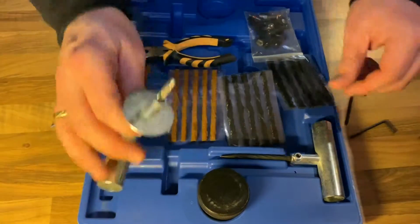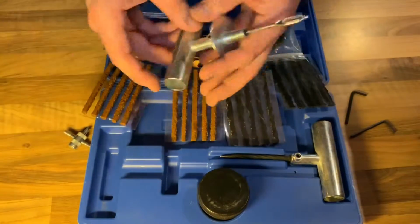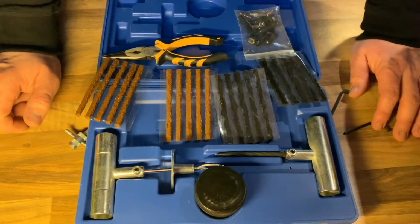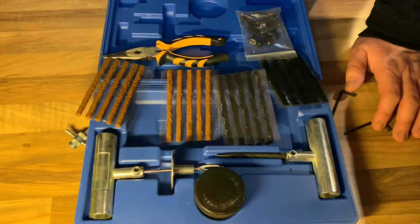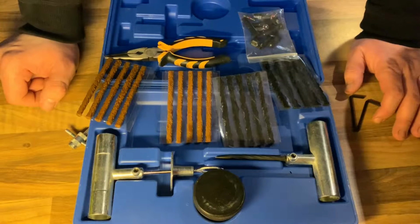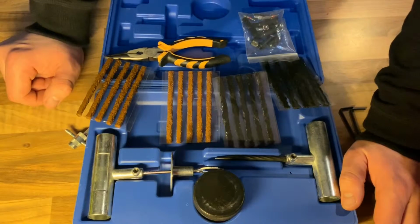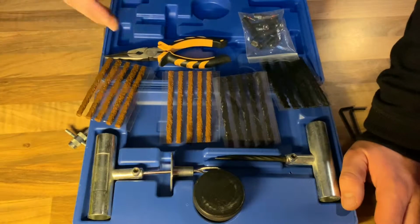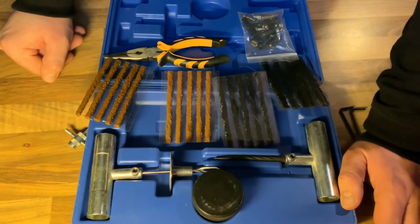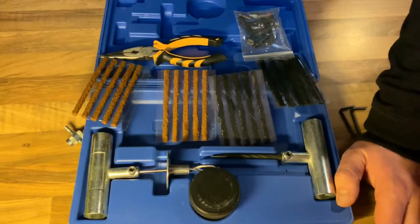And then the only thing you have to do is cut the outstanding parts from the self-vulcanization repair plugs on the surface of your tire. That is it. After this, you can inflate the tire with the right pressure and then go back to the road. And this will only need, I think, 5 until 10 minutes. And you can do this where you want. Easy, easy, easy.